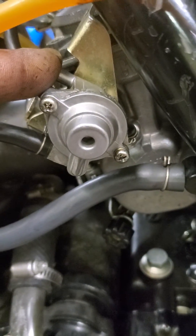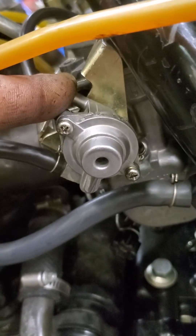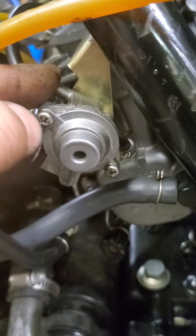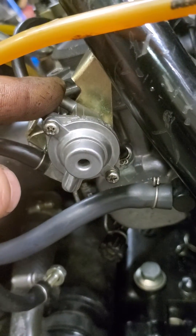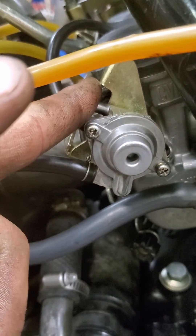Normally, it's by applying vented air to it. As soon as you take your finger off this, if the idle goes up, that means the valve inside is allowing air to pass because it's not sealing. So when you let off and the idle picks up, that's a vacuum leak.